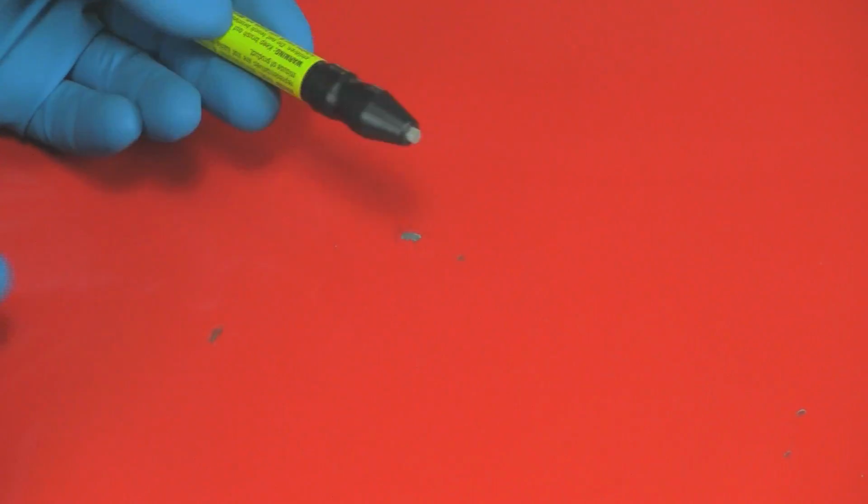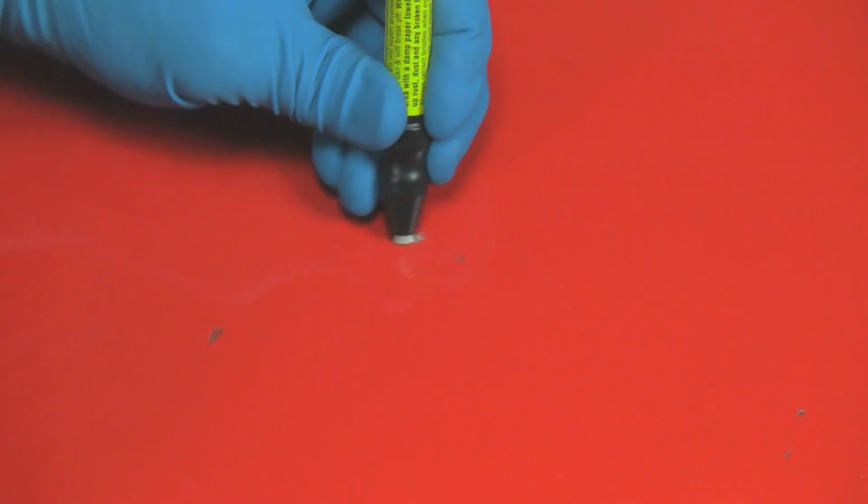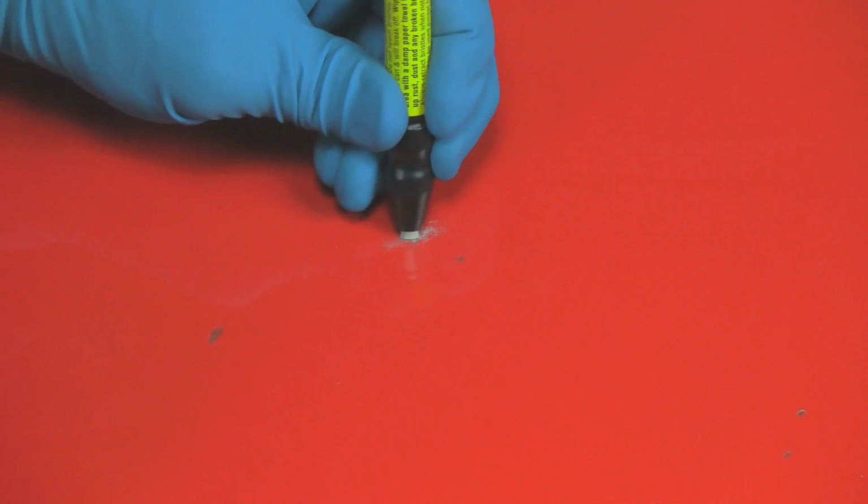Okay, now we need to clean out these chips so the paint can adhere properly to the metal. We'll use this Wurth Sanding Pen. This is multiple fiberglass fibers in a wider rod, and they act, when they're short and stiff, like a little piece of sanding paper. To get smaller chips, we can also trim this to a sharper point. These big ones, we should be okay with it the way it is. So we'll go in and clean out the chips.